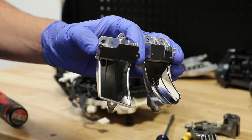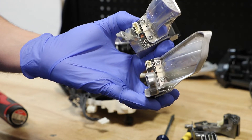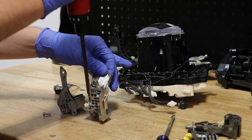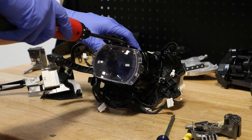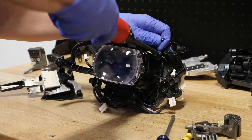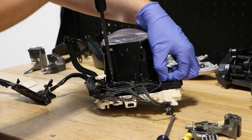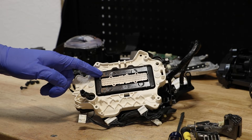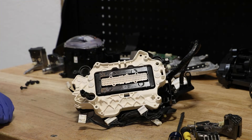The reflector on each side LED unit is held in place by two T10 Torx screws. Next I'm going to remove the lens holder by removing the T20 Torx screws. Next I'm going to remove this bracket holding on the LED reflector — there are four T20 Torx screws all held in at an angle.